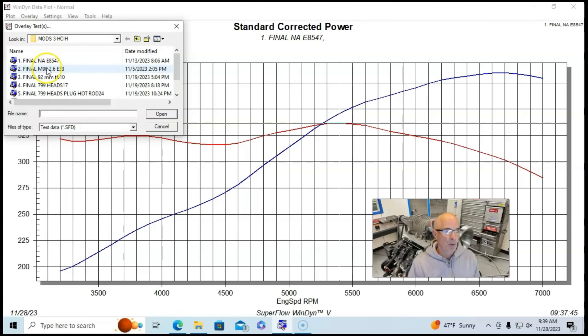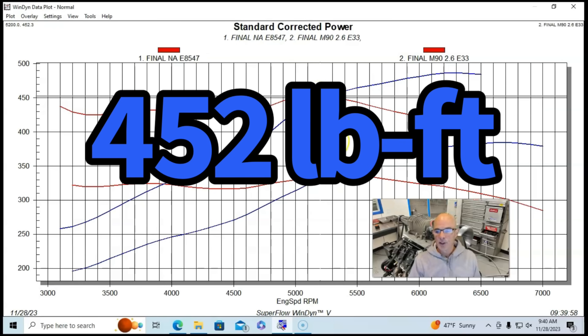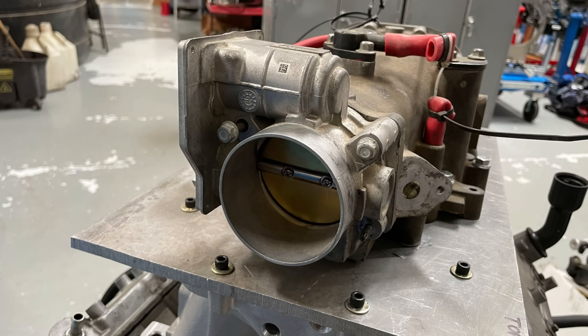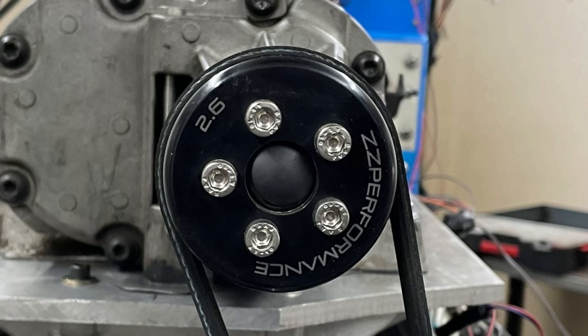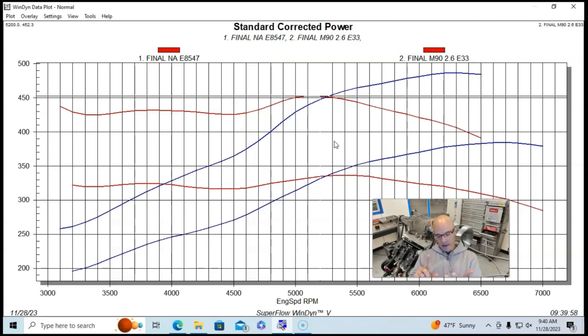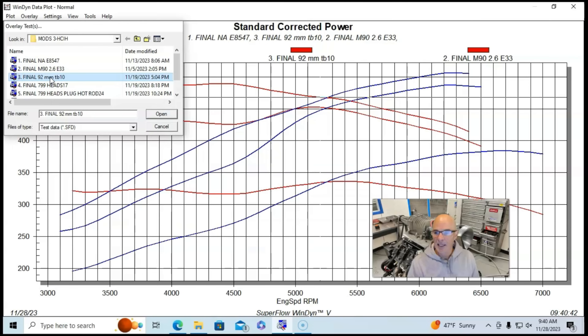Here's what happened when we first ran our M90 supercharger: it produced 487 horsepower and 452 foot-pounds of torque. This was the M90 Gen 5 blower with the factory Gen 5 throttle body converted to a manual throttle body, a 2.6-inch pulley, and factory crank pulley. All combinations were run with accessories — water pump, power steering. The alternator was not hooked up on the blower combination but was on the NA combination. With further modifications — port-matching the inlet into the blower and adding a 92mm FAST throttle body — we went up to 507 horsepower.